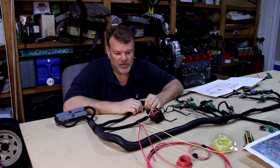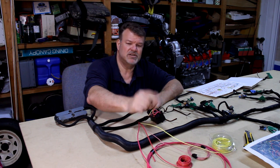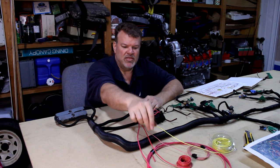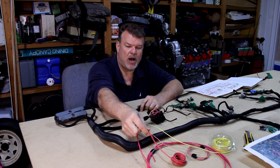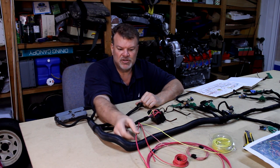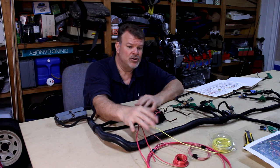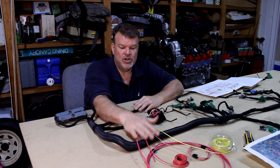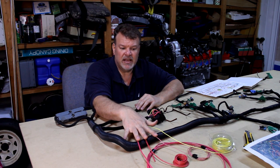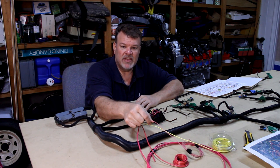If you'd like to follow along, I'd love for you to continue. Let's start — I'll get rid of two of these wires by talking about them. This yellow wire is my fuel pump wire; it goes back down the chassis all the way to the fuel pump and provides power to it — that's a simple wire. This red wire goes straight to the battery; I'll have a little junction box but it goes straight to the battery. It's this pink wire and this wire — which on my diagram is the purple wire — that are the two we're going to have to figure out how to connect. I'll show you how I'm going to connect it in my Jeep CJ7. If you've got a newer Jeep or any kind of car, you'll have to figure this piece out for your vehicle.